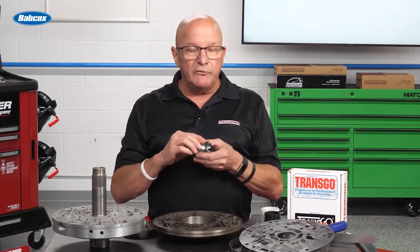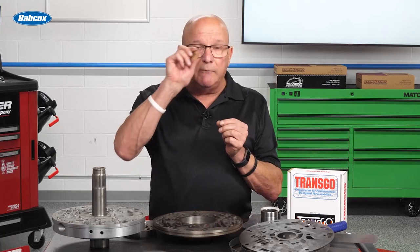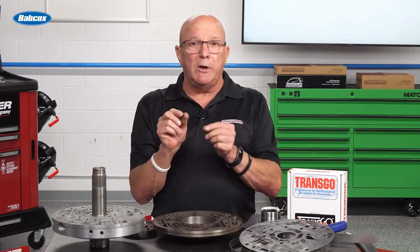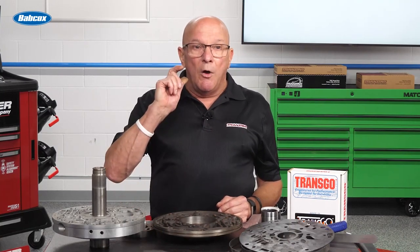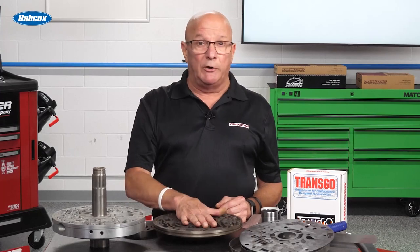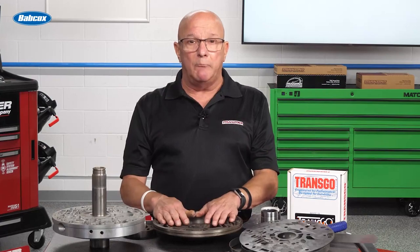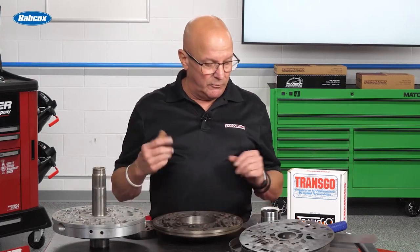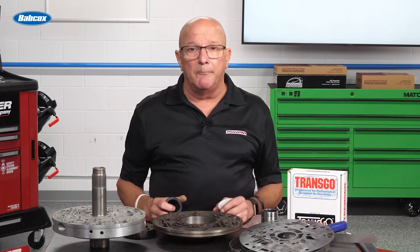Always try to check the bushing you pull out. When you press that bushing out, take a mic and go around it — it should be somewhat even all the way around. If you pull it out and it's thicker on one side than the other without substantial wear, you now have to really watch yourself because the bushing you're putting in will move the center line. If it's 63 on one side and 59 on the other, that's at the far end of the scale. It's almost better to just put in a new pump, or take it to a machine shop and have it line bored. And that's why I mentioned the A4LD — because on Ford, you couldn't really use bands; close isn't good enough when talking about a front pump bushing.